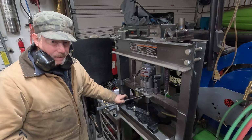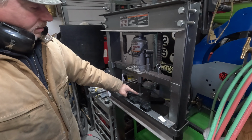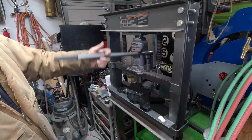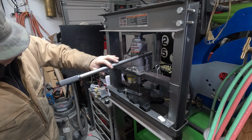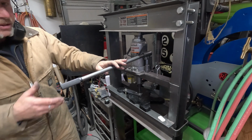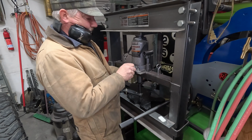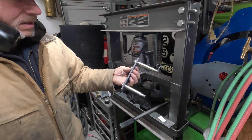Now if you get down here and look, maybe let's lower you down. Okay, can you see right there? All we're going to do is press until this meets that. Not very far, and it certainly doesn't take much force. But you're not going to be able to push it in by hand. And we're almost there. There it is. That's all the way down. Release the tension. Compress it all the way since I got 2 more to do. And there it is. Preset shackle.